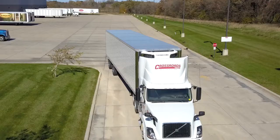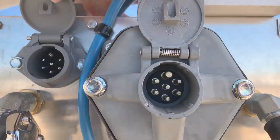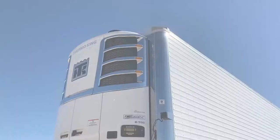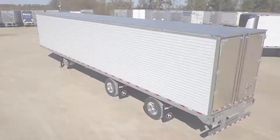The features on this trailer consist of: full stainless steel front and corner radius, cast top corner radius protection piece, stainless steel turn-up on pickup plate and stainless steel bottom radius surround, nose-mounted interior dome light switch, extra 7-way electric plug mounted on the nose, large refrigeration hole to facilitate Carrier or Thermo King units, and 9 PC-rated LED lights on the top and bottom rails.